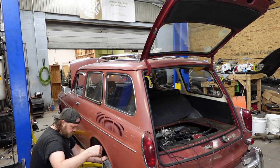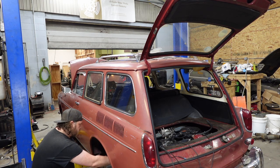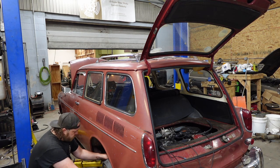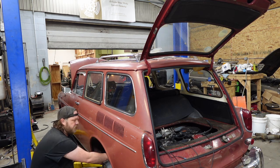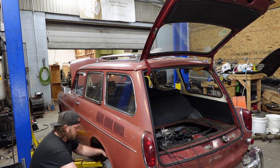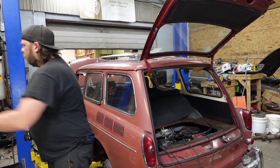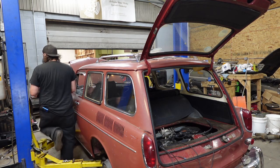All right, drain the line. Put the line back on, and let's see if we can watch the flow. I want to make sure it has a decent flow rate coming out of here. I know you can't see what I'm doing. Bubbles, fluids coming out. Oh yeah, she's flowing fine. All right, perfect. I guess it just had an air block that my bleeder couldn't push out. Or it was slowly pushing it, but sometimes just push the pedal and make it work faster.